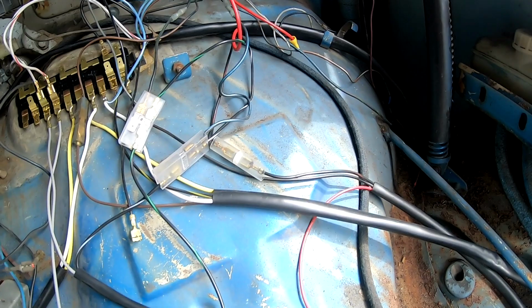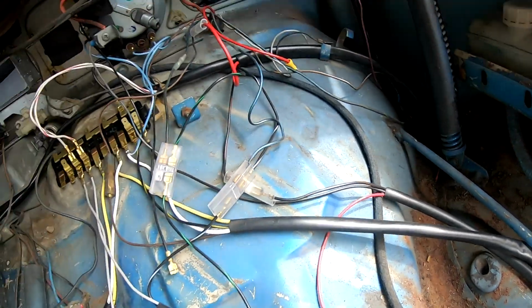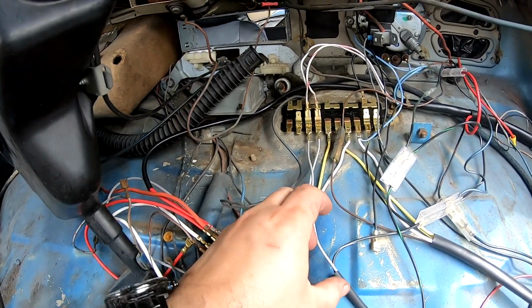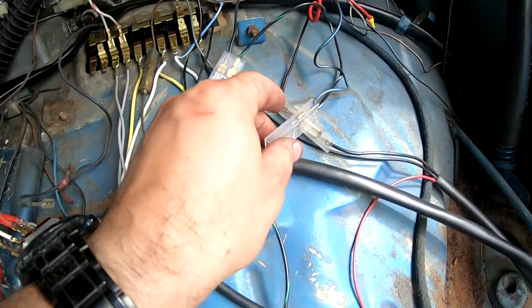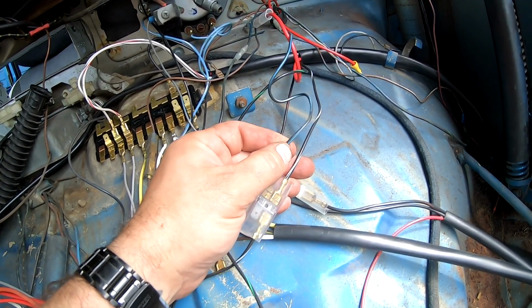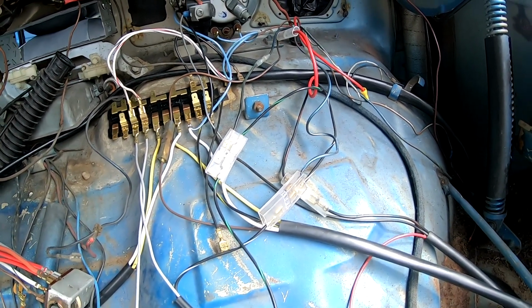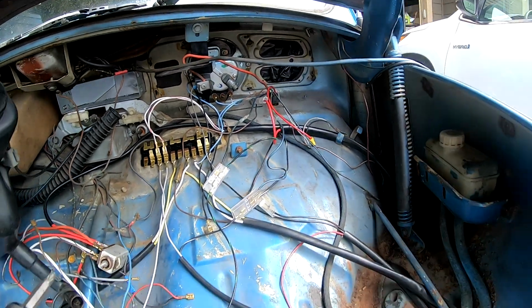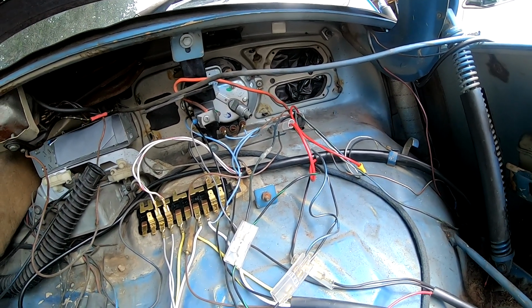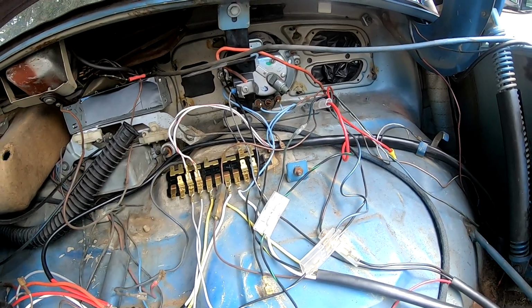Yeah, and then on the driver's side, it's basically all the same, but the gray gets put on the 4th from the left, and then the black with white stripe goes into a 4 connector, and again black with white stripe coming from the main harness, and then the black with white stripe coming from the signal. So we'll see when I test it out whether the blinkers are all in the right place. Because coming from the signal is black with green or white stripe. Doesn't mean they're connected right on that end, so we'll see if I have to flip it.